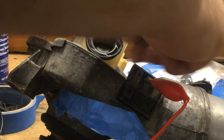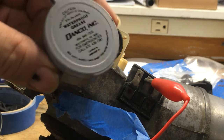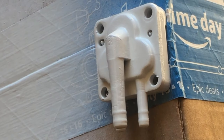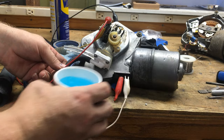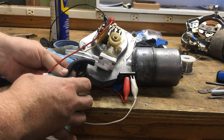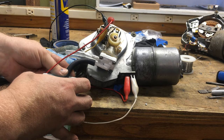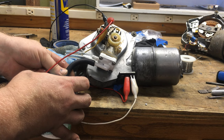To reassemble this, I'm putting it back in with a lot of waterproof grease across it. I've also painted the input and output connections and then reassembled it with those four screws. Then we're going to give it a test with a little bit of washer fluid with power applied to the pump and to the motor. You can see it is pumping just fine.